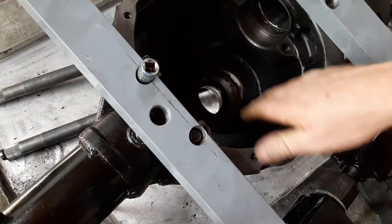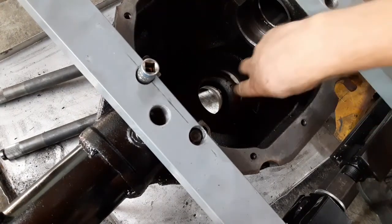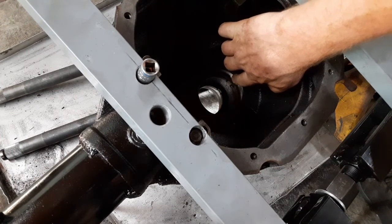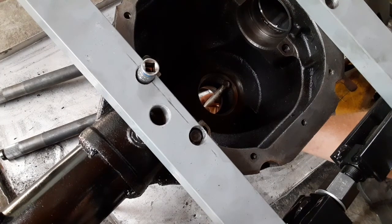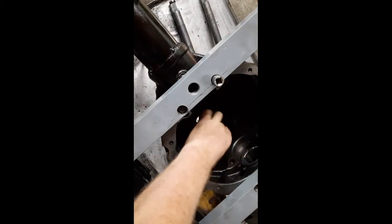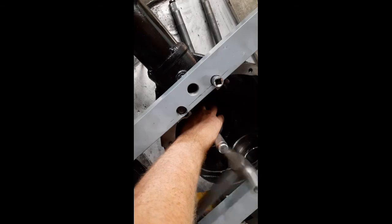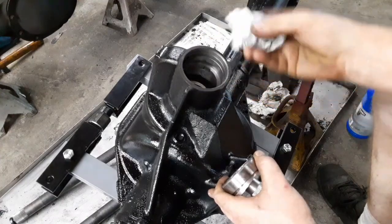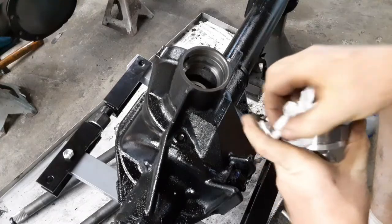When you're ready to put all your new stuff in, knock your old races out first. All I used was a chunk of aluminum. If you look you can see a notch on both race seats, and you just bring the punch up into that notch section, hit it on one side, go to the other, hit it - just keep working back and forth. Then we'll drive the race down in there. Then we'll repeat the process with the outer race also. Make sure everything is really clean - one final wipe-down of the race.